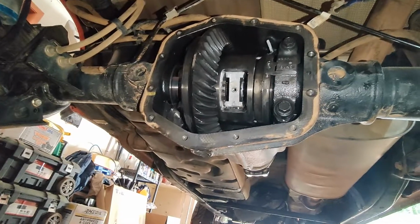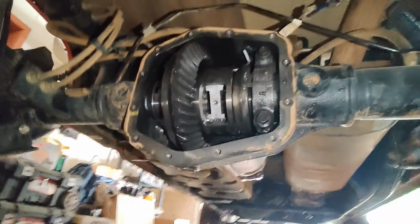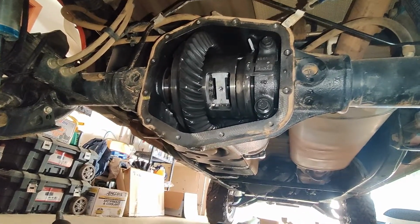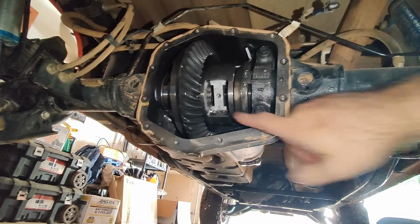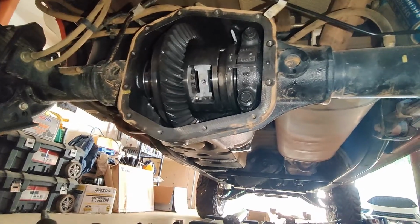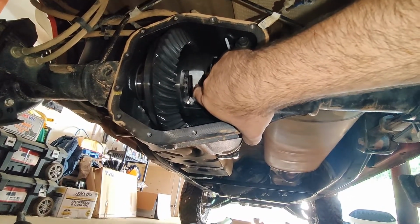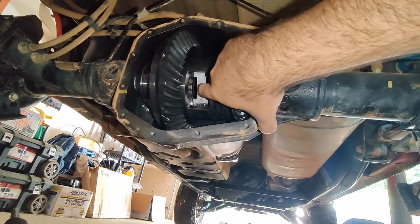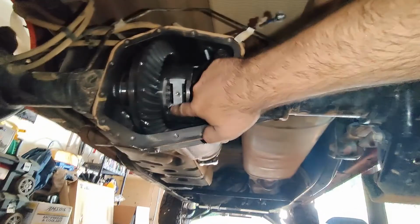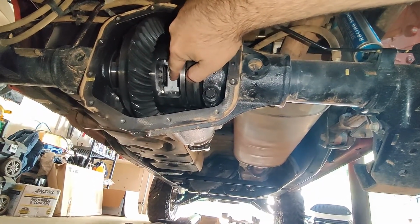I've got a little bit of time once I pull this out and get my backlash and everything set and get the shims set. I'll probably be waiting to fully install this until I get this part, because I'll end up having to take the carrier completely apart to get that out and replace it. Today we'll be looking for this part. I'm really not a big fan of how loose that is, or the wear. When it's attached, it's still loose. It can slide with the pin.